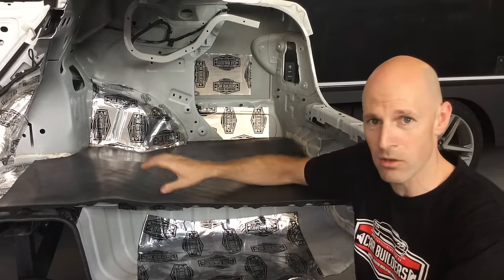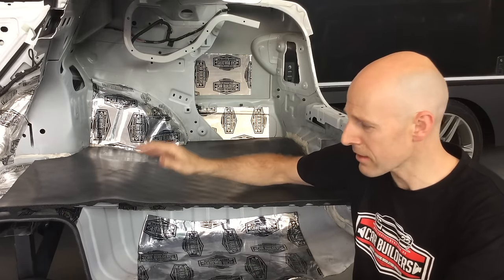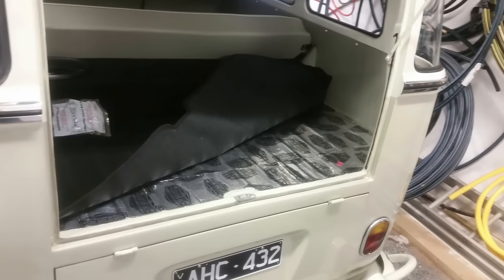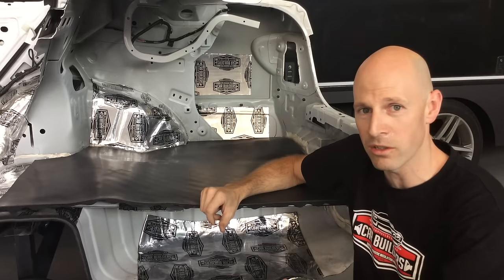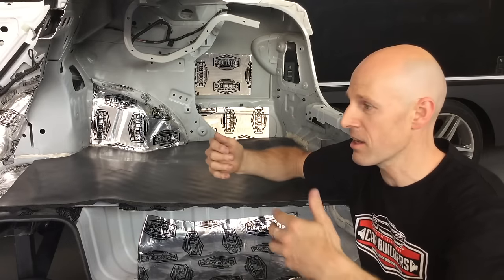You will find it across wheelhouses also. If you've got a diesel vehicle, a commercial vehicle, or a truck, this is essential to stop that noise coming through the floor pan and into the car. Another application is as a drop-in — think of it as a removable sound deadener. In your boot application, it's ideal to drop it in as a blanket to smother exhaust noise coming through. You can lift it up to access your spare wheel. Other applications include firewalls, transmission tunnels, wheelhouses, and behind rear seat backs rather than trying to insulate your boot — you could just put a curtain straight across to stop that sound coming through the car.